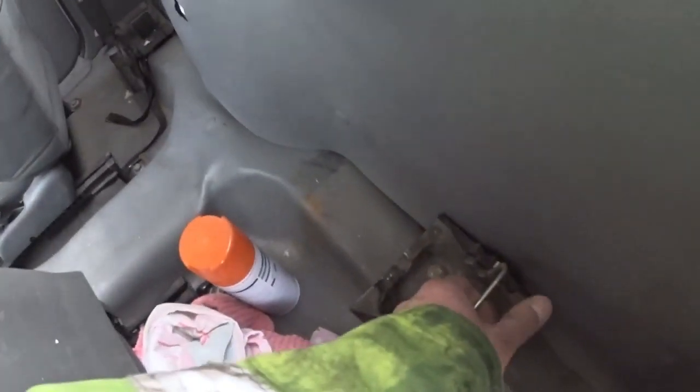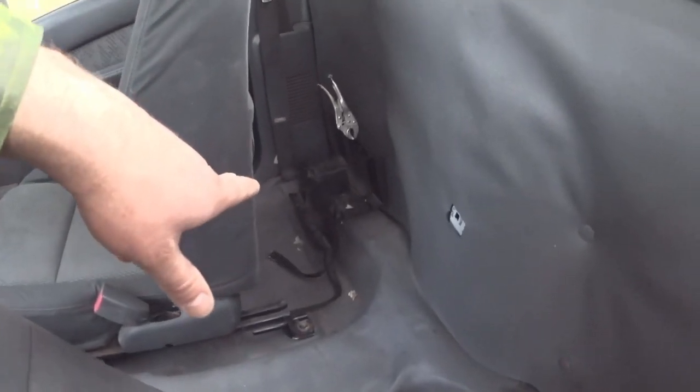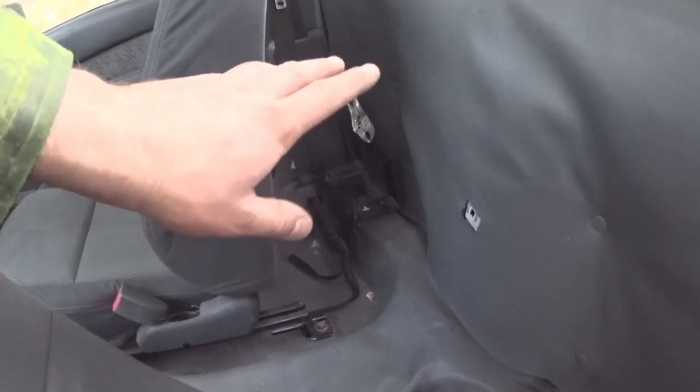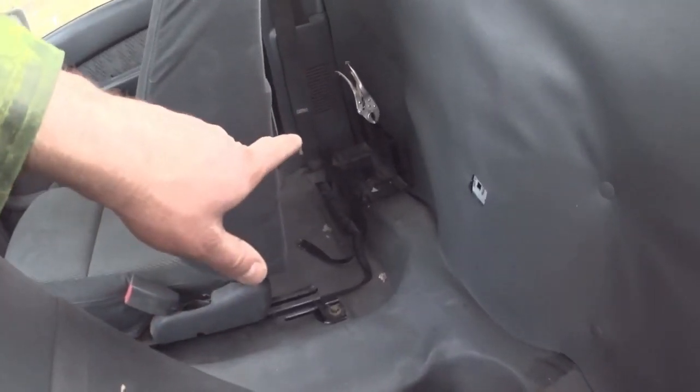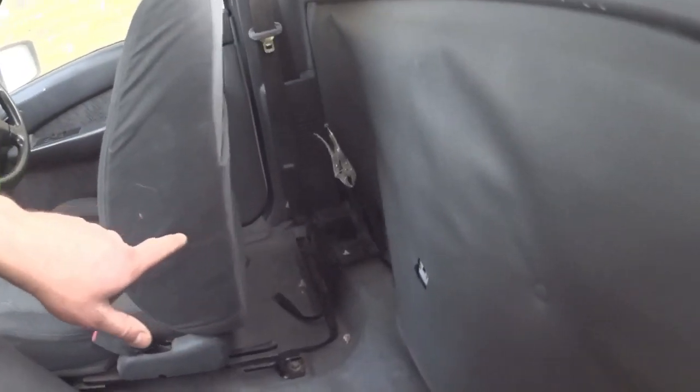I'm going to stick the jack here, and I think I've got a spare toolkit, but really all you'll need is that bar to get the spare wheel down with a hook on the end of it to do the jack, and a 21mm socket. I think they do give you some screwdrivers in the factory one, but that really ain't much good, is it? What are you going to take off with a screwdriver? Not even the headlamps take a screwdriver. Well, the side light does, but you'd be better off having a 10mm to change a headlight bulb on the left-hand side. If it's a Mark II, the washer bottle's behind the headlight. But anyways.